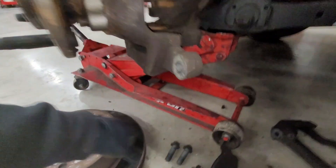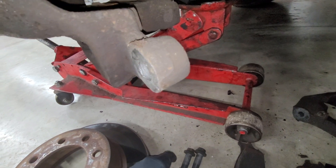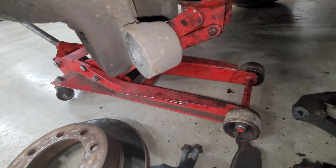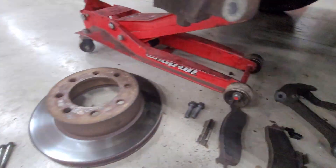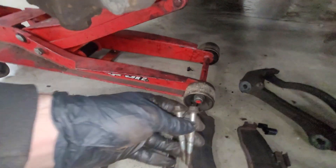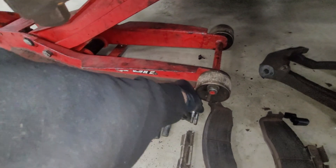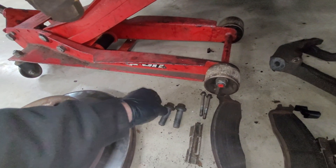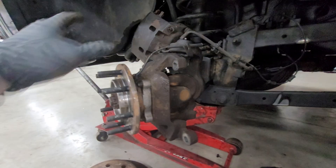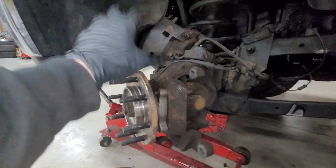I have caliper grease up in there. The anti-seize on these is pretty good — these usually don't come loose. It's usually these little 10 mil bolts. I've actually lost a few of them back in the day, so a little bit of Loctite on these is pretty nice. These bigger ones you can anti-seize — they're big and beefy so they're not going to come loose. I'm going to pull this off real quick and the part should be in tomorrow to finish this up.